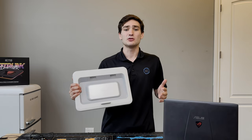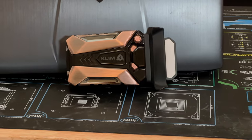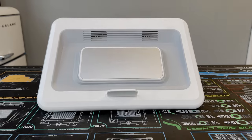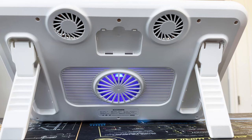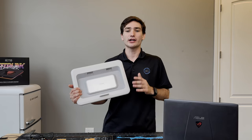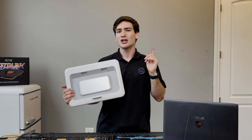When we ran our CPU stress test using AIDA64, this cooler was actually able to outperform most of the other coolers, just falling short of the iets GT500v2 and the ClimaCool Plus vacuum laptop cooler — which is quite impressive, as those coolers have pretty much wiped the board against everything else we've tested. However, there is one thing to keep in mind: noise. This laptop cooler is pretty noisy at around 51.4 decibels, the third highest in our tests, and it can get quite annoying at full speed with the fans and thermoelectric cooler running, unless you have headphones on.